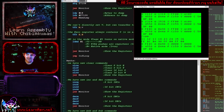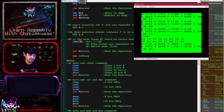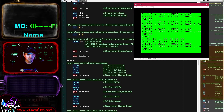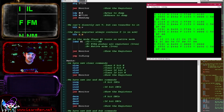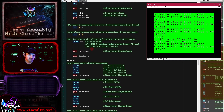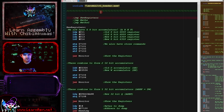The final one is the mode register. We don't really need to play around with these commands much, but we can turn on native mode by loading the MD register with the value 1, which sets the bottom bit. Native mode alters the way that interrupts occur. We also have a fast IRQ option, which changes the way registers are pushed onto the stack during an IRQ. As I say, we don't really need them here - it's just to make clear that we have that new register.